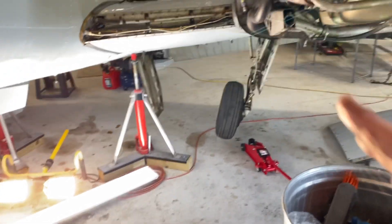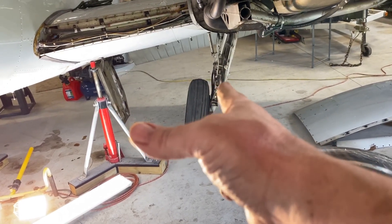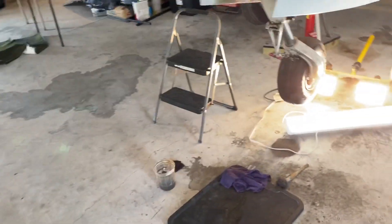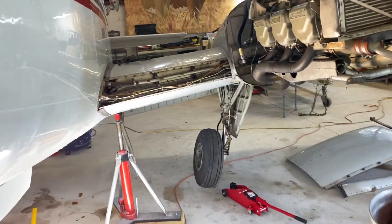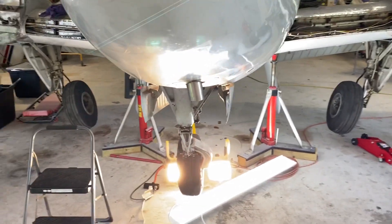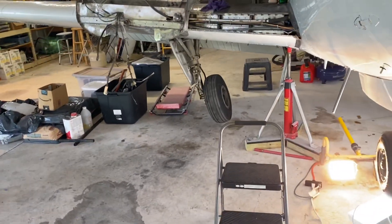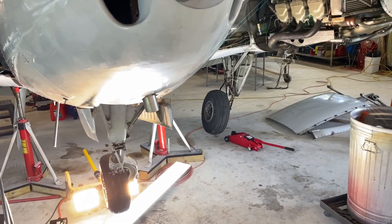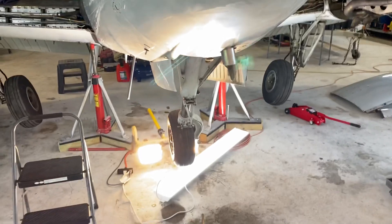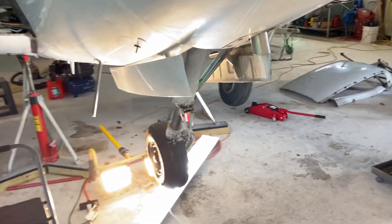Long story short, this strut needs to come apart — all the bronze/brass bushings need to get changed out. It's not a big deal: drive out the old one, drive in a new one, check bolt size, ream it a little for clearance. It's just time-consuming, and when you're paying a shop $75 to $125 an hour, this is a lot of work. It's taken me a couple hours just to clean the front, and I haven't even gotten to the sides — it's all nasty up underneath here.